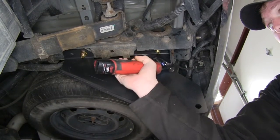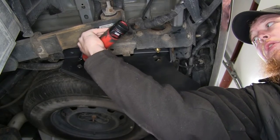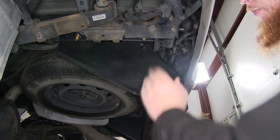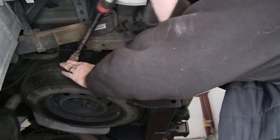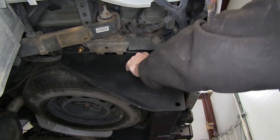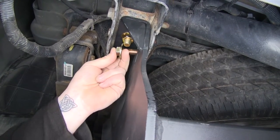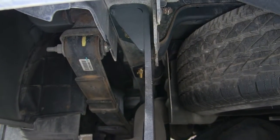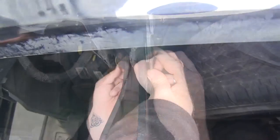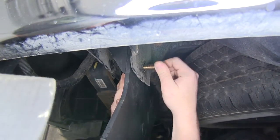Go ahead and tighten down the two carriage bolts and flange nuts here on each side. Now we'll go ahead and torque the two outer bolts on each side to manufacturer specifications before we put through the hex head bolt located there. Now we're going to place our hex head bolt and flat washer through the top hole and through the frame. There's going to be a gap, so we'll use the spacers to go in between the gap so that we don't bend our bracket. Put the spacer in between the two, press it through, and then put our flange nut on the opposite side.